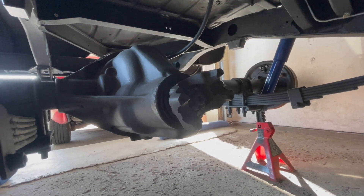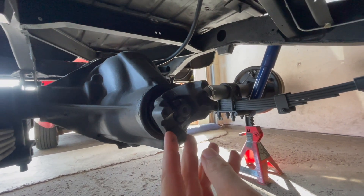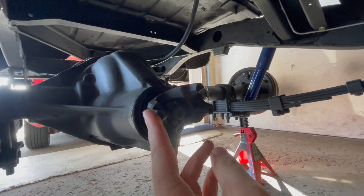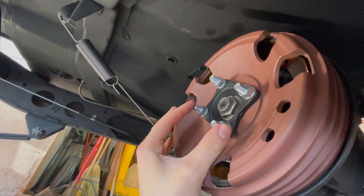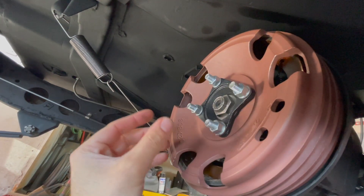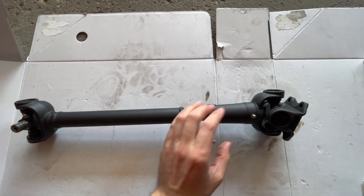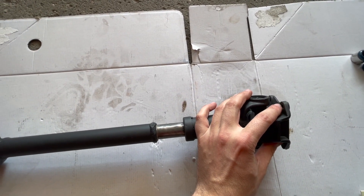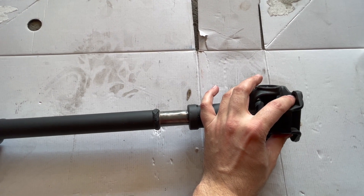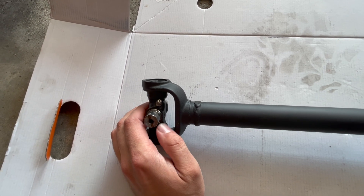We are now underneath the Jeep to get a better sense of where the rear drive shaft is going to go. It's going to connect to this rear yoke right here, which is attached to the axle, and the other side will be attached to the emergency brake onto the four studs coming out of it. It's important to have the rear drive shaft oriented in the right direction — the larger bracket with the four holes attaches to the emergency brake or transfer case side, and the other side attaches to the rear axle yoke.